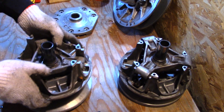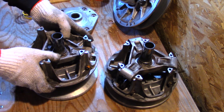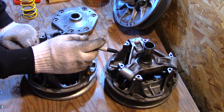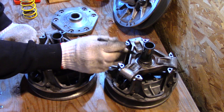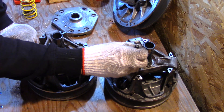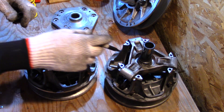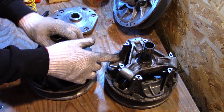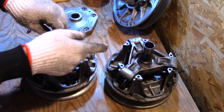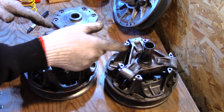Good clutch here, bad clutch there. I'll get the camera closer so you can see what I'm talking about. On my last clutch I had a spider failure — on the inside of the spider there was a crack which caused the sheaves to actually move closer together. That's not what happened this time. People were giving me a hard time about belt deflection being too tight — no, the primary clutch was cracked. I'll show you what happened on that one because this one's a little different.